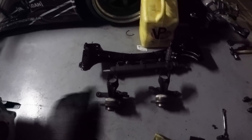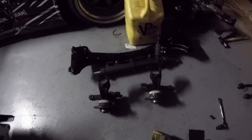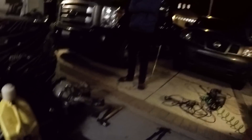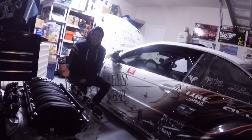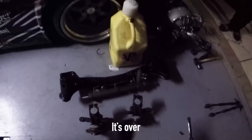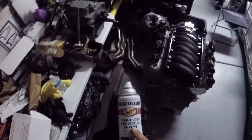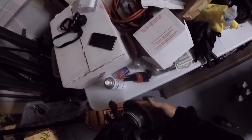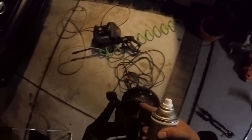So that's the knuckles — they're a lot cleaner. Now what we can do is spray a nice coat of semi-gloss black on them: not shiny, but not super dull either. We got our Rust-Oleum semi-gloss protective enamel. We'll paint the whole thing black except the mating surface — remember, no surface black. I'm just going to hang this out and spray it. Sorry about the trees, California.